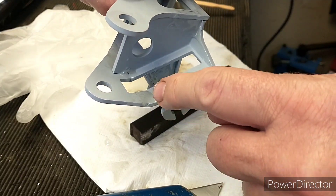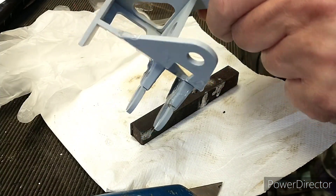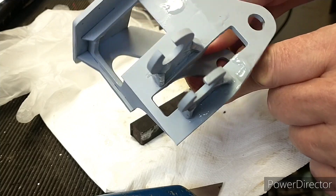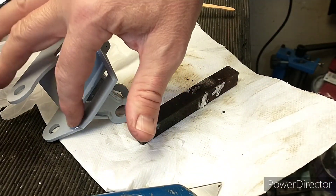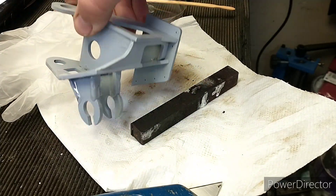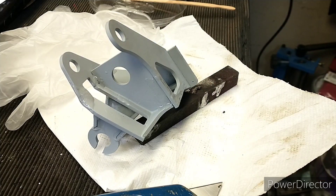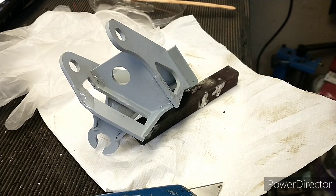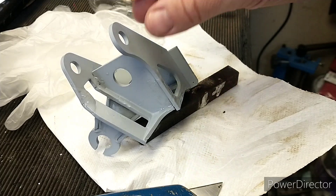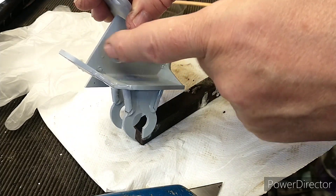The bit where I undercut slightly, I've put some epoxy there and filled in this hole and also on the inside. Hopefully you can see all that. So that's just started to go off now, it's just starting to harden. You can see I've primed it. I'll rub these bits down once the epoxy is fully dry. I can give it a coat of black, but the next job now is to address the bushes that go into all these holes.